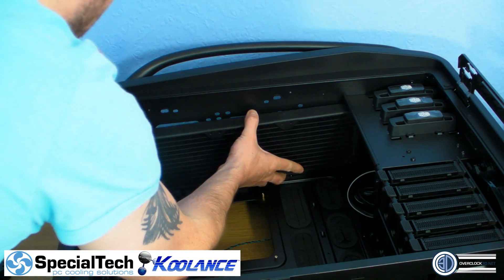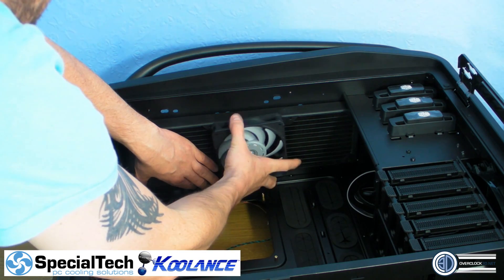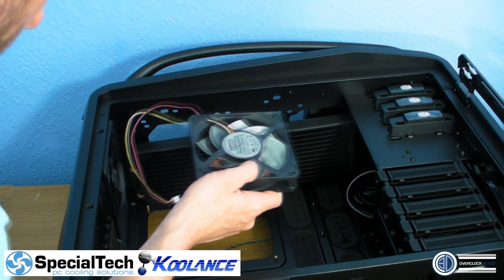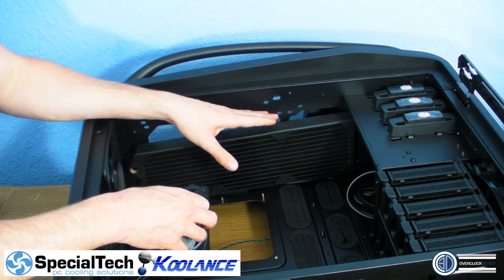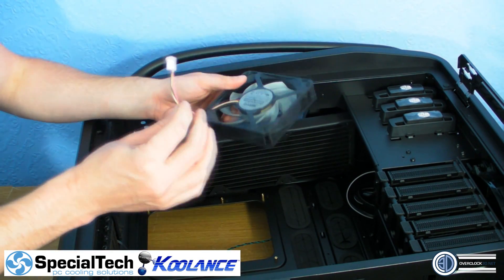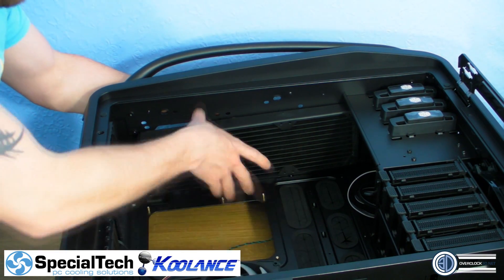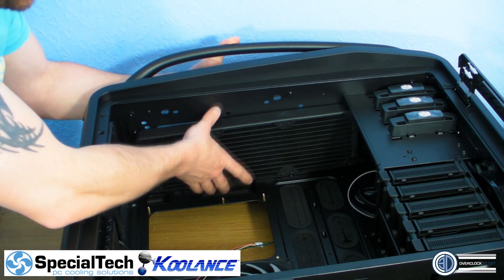So there were some tabs at the end. With the radiator in, I've got two options: either have the fan below, or put the fans outside and have them pulling through. Even better, go for a set of fans on the inside and a set on the outside for push-pull because we've got enough room - you can put fans outside. But the fan cables are quite short, so at the moment I'm thinking of having the radiator screwed in and then having the fans blowing through it - that'll also give a little bit more active cooling to parts around the board.